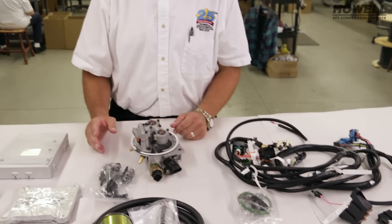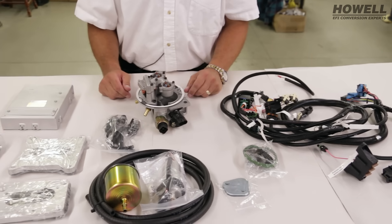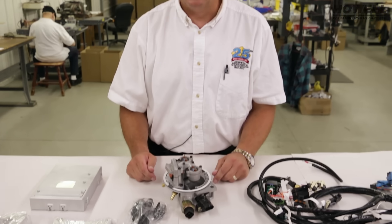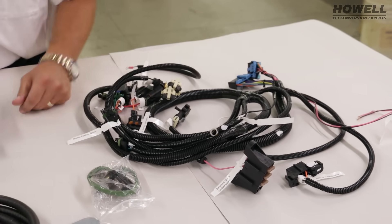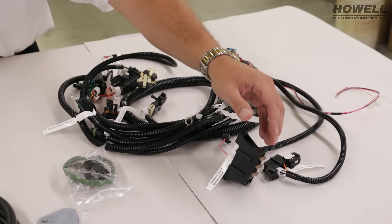What's on the table here are the components involved in a normal throttle body kit. We really sell a tremendous amount of these kits to a lot of other applications — any V6 or V8 carbureted engine that has something for the ignition system other than points. You've got a standalone harness, everything covered and terminated, much like a lot of our other designs. Check engine light installed, diagnostic lead, fuse block.